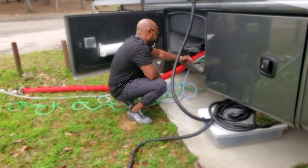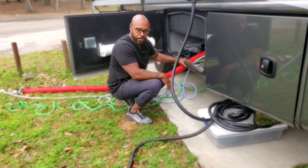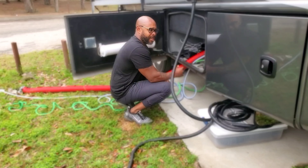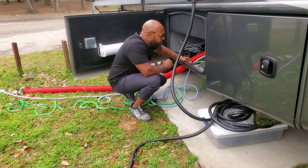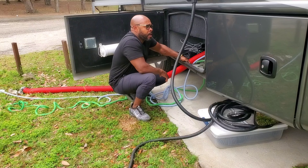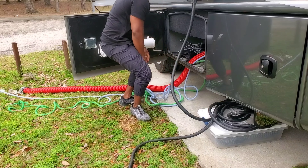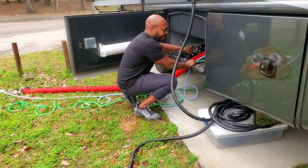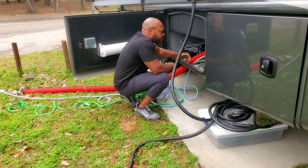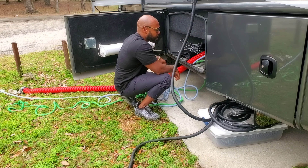It's important to keep everything nice and neat down here — you don't want a mess. I like to keep my cords off the ground, keep them nice and clean. These things are heavy-duty weatherproof. Now that we've got 45 gallons pumping to our black tank, the next step is just flush it out. You want to keep flushing until clear water comes out — it'll be coming out pretty colorful at first. If you need to do another round, you can do another round just to churn everything up and flush again until the water comes out nice and clear.